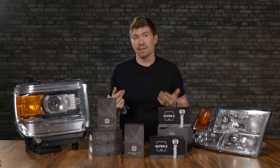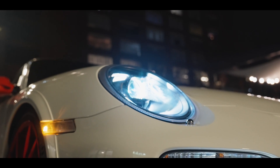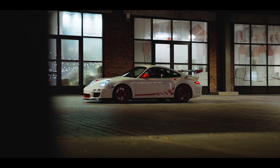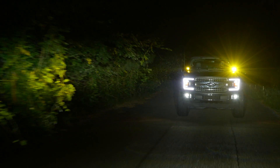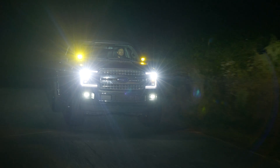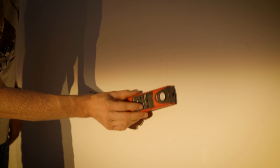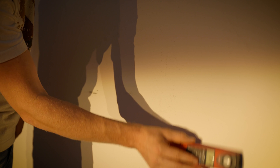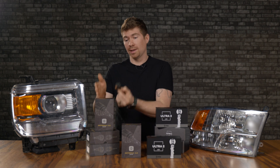We never really did that test with the Ultra 2 — we'd just turn it on and say, look how bright this is. Every single aftermarket LED replacement bulb, headlight housing, or fog light loses brightness over time, having less lux or actual usable brightness at a certain point. That's what we're measuring today — lux. We're using a digital lux meter to measure the actual usable brightness. It's one really good measurement that helps me compare one light to another.